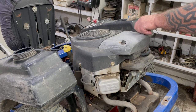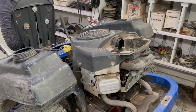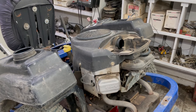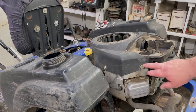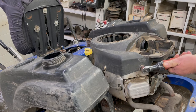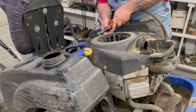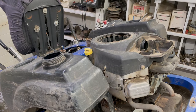We'll go ahead and take the air filter cover off. There's two quarter-inch screws we got to take out. Then we'll take the cover off the flywheel — those are five-sixteenths, there's four of them. All the bolts on the side here we're only taking out halfway so we can slide this thing up. The two front ones are seven-sixteenths on this one for some reason, but normally they're all three-eighths. I'll pop these all loose with my air.